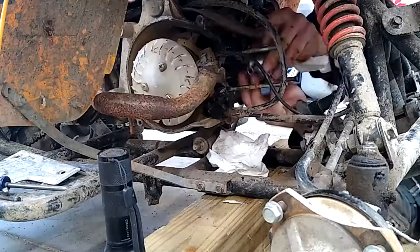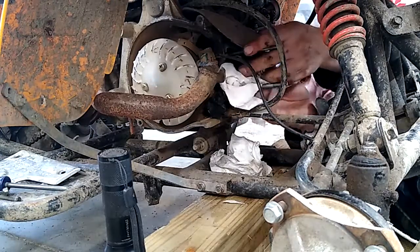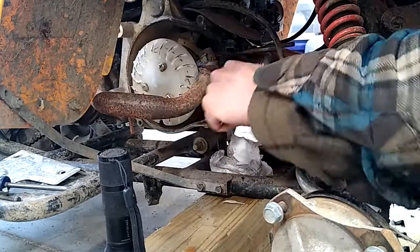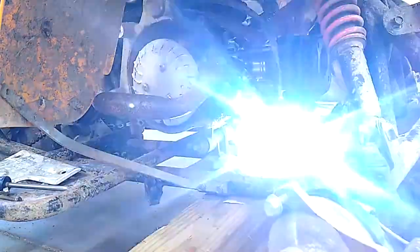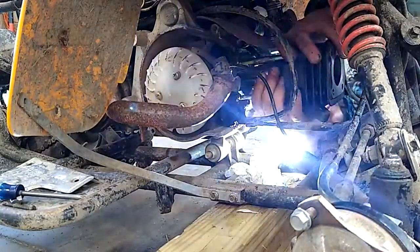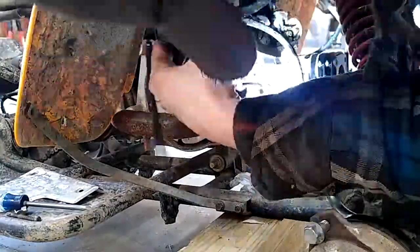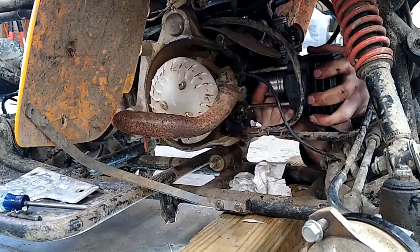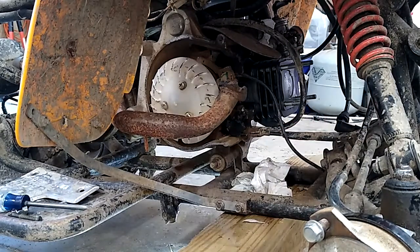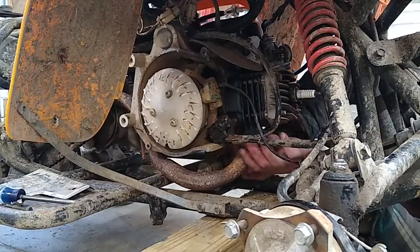There's very little space so reassembly is quite difficult. But with a little patience you can get the piston back onto the connecting rod. The spring that retains the wrist pin was particularly difficult to get on because of the location, but the easy way seemed to be to physically get it to hook on the piston and then rotate it as if you're screwing it into the piston. Piston rings can only fit on one way so that they clear an alignment pin. Some dexterity is required to get the head past the piston without special tools while rotating the piston rings and squeezing them to align with the pins. There are special tools that help do this, but I didn't have one and I'm not sure if you can get one that fits a piston this small.